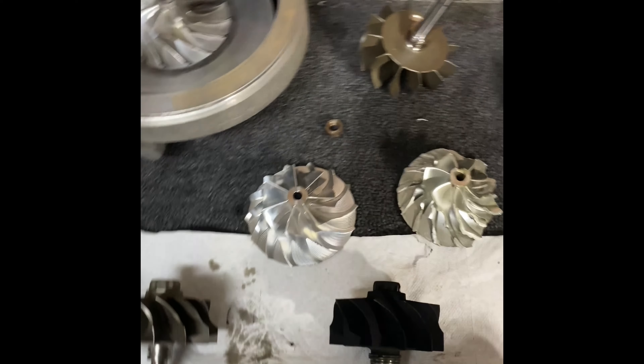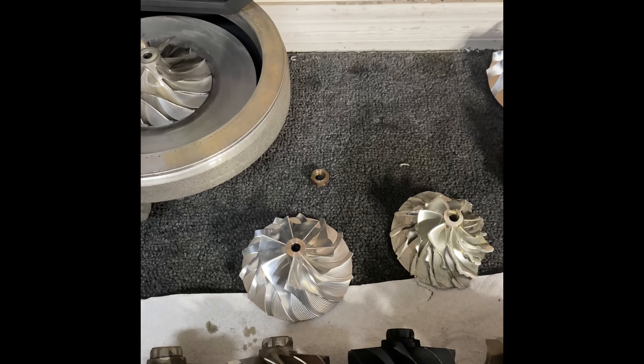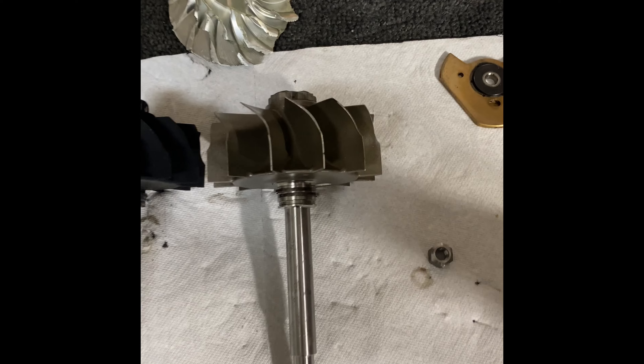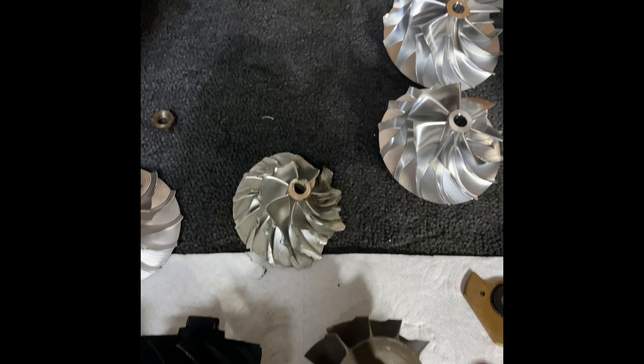Do I suggest them? Yeah, they have a great place. I really like them for the Cummins application. We are doing a 67, 77, and a 16cm gated housing, and we're going to pair that next to an HX-60 — we're going to put the HX-60 next to an HX-50. It's massive. HX-60 is by far one of my favorite platforms, though they are very expensive chargers. We are going to be doing a 67-80 set of compounds.